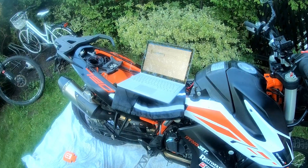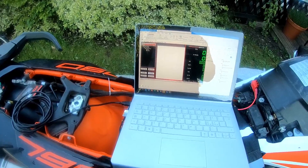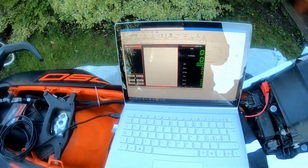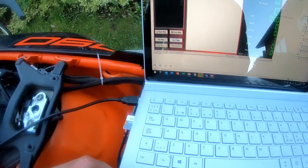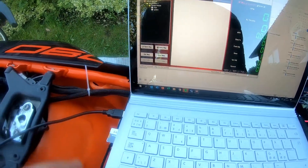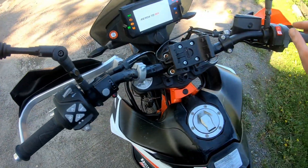Now it's the last part — installing a map adapted to the new intake on the Power Commander. Using the Power Commander is really easy: you hook it up via USB to your computer, download the app from Power Commander, open the map — you can download maps from Rottweiler, and you get some for free when you buy the Power Commander. If you want more it costs about $50. Then you just hit 'send map' and it gets uploaded to the Power Commander. Now let's start it up for the first time and see if it works.